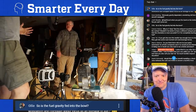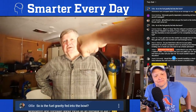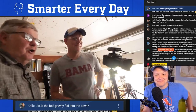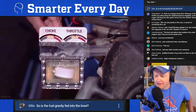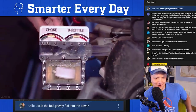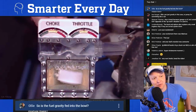Okay, did you catch it? I think I hit the buttons. It was running rich. It was sputtering. So I opened the choke up so it'd lean out the mixture and it started running smoother. Like it was actually supposed to be used? Well, yeah, that's where it's supposed to work. I didn't know there'd be bubbles and things here. Oh, look at that. You can see that the carburetor's over full here. Gas is over the bowl, or over the float. That's not normal.